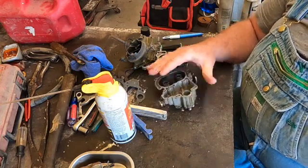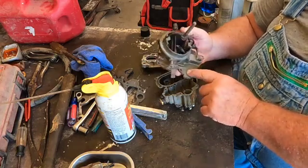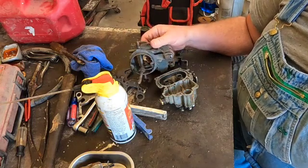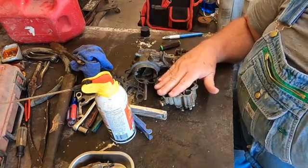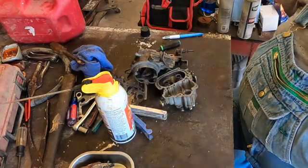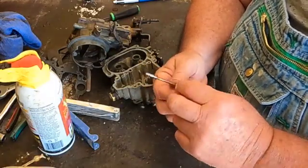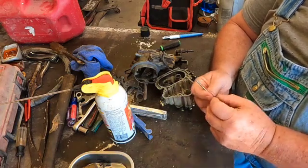I just want to get the truck running and make sure all the passages are clear and look for any problems. There's supposed to be a stamp on the top cover but I can barely make out some numbering — it's not legible. So I went through the internet looking for clues to tell me which series this carburetor is. I think I got it narrowed down to a 7150 kit, and what leads me to that is the accelerator pump plunger — this particular one has multiple notches or grooves cut in it, and that was the only kit with this plunger on the website I was on.